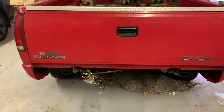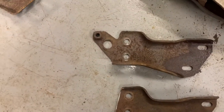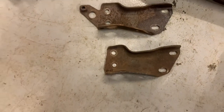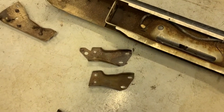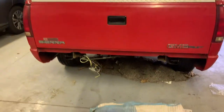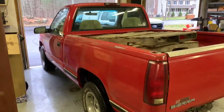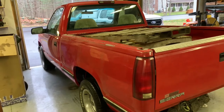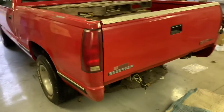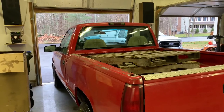I'm going to work on mounting the rear bumper, which should suck the back of the frame in and hopefully give me proper suspension alignment. On top is a factory bumper bracket — I trimmed off that ear to clear the hardware for the rear spring hangers. I'll mark it out, drill some holes, stab the bumper on there, and maybe if I get ambitious I'll put the stacks back on. But that's pretty much it — going through as I edit to see if there's anything I missed.